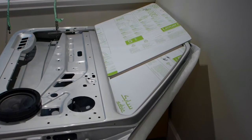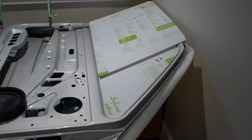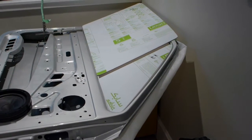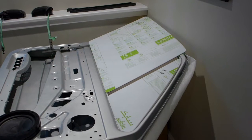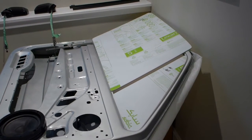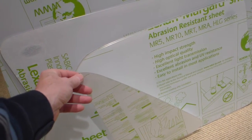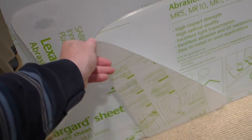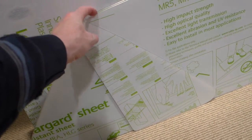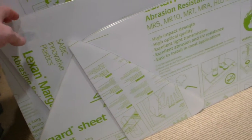These are the Margard Lexan polycarbonate windows from AWS Plastics in Bristol, England, and they did a beautiful job. The previous ones from the LWS design guys who did my carbon fiber panels were outsourced to someone else. The difference is that these use the proper scratch-resistant material — which LWS never did, and charged me for it without replacing them — and the edges are beveled as normal glass would be. It's a seven-piece kit: the quarters, the main roll-up front windows, sides, and then the rear.